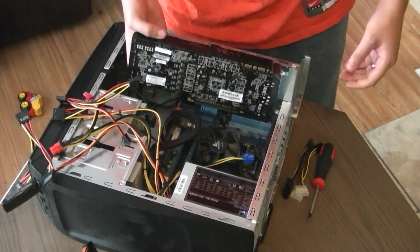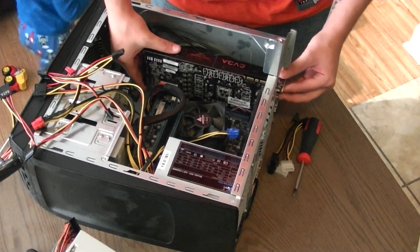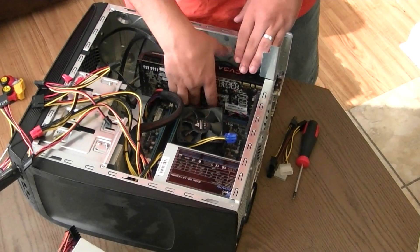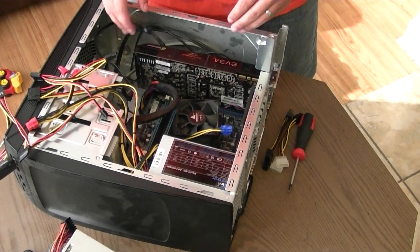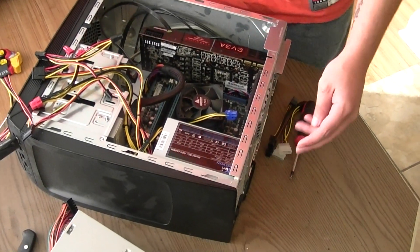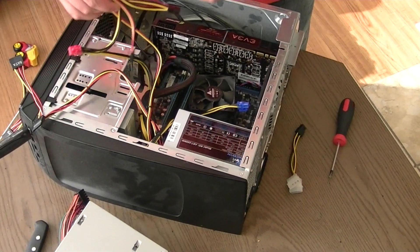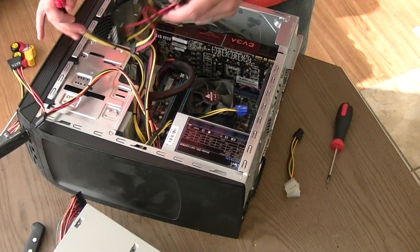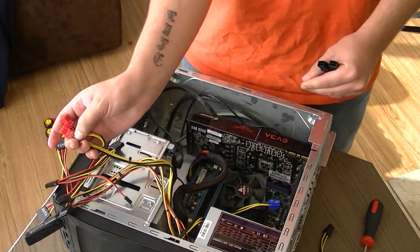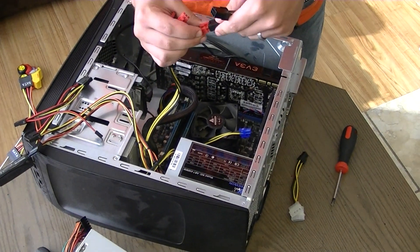This thing's massive. You just push it right down in the PCI slot and it snaps in place. The retaining clip I forgot earlier just kind of snaps in place once you do that. The video card moves a little, but once I put this latch down it doesn't even budge. Now I need to get my two cables to connect to the video card. These marked in red are my two six-pin PCIs — it says right here SLI ready, PCI Express. These go right into these other six pins.